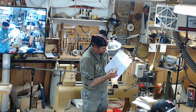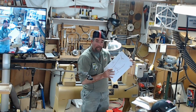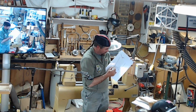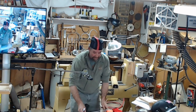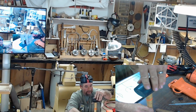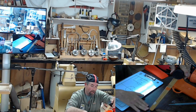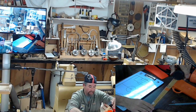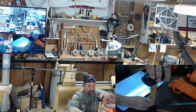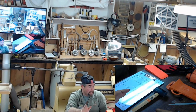And then right there at the end, you want to have your last 2 inches. You don't want to cut through that. This is what we call the holding wood or hinge wood. This is another one that's going to save your life. Because if you cut all the way through this thing, when it starts to fall, now that weight is not coming straight down. Now the weight wants to kick back. So if you cut all the way through your notch, this thing can literally jump back off the stump and come back at you while you're cutting. So you want to have that hinge wood.